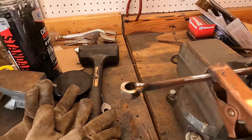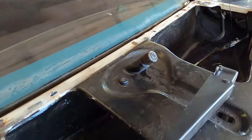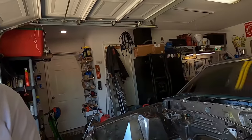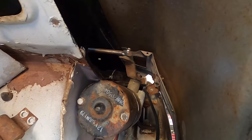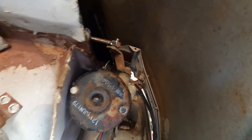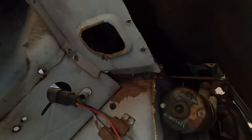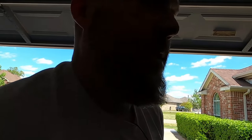Just tacked that on. We got movement and squeaking back there. Got the fender on and checked for clearance. It is zip tied and functioning — it's just so close to hitting the fender. So it's working; I just need to bring it in a little bit more. It's also binding because this rod keeps slipping. Let me take the fender off and show you.